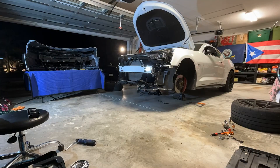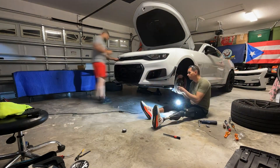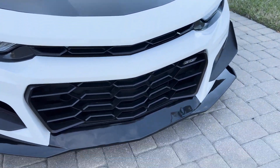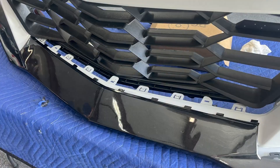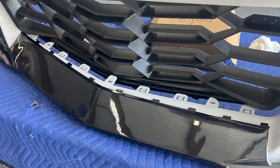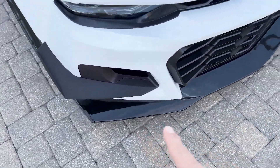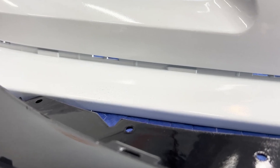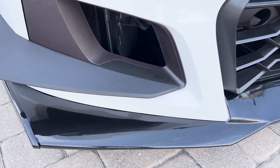We're about to put it on and see if it works. When you get all the bumper pieces together, it's fairly simple. I would recommend starting with the lip - we put the grill first and then had to take it off because the lip has little tabs that go in between the grill and the actual bumper. When we put the lip or front spoiler on, it has clips that go in but also two little ledges that have to go over, and those are a little hard. We used some 3M tape to raise it and get it into the clip.